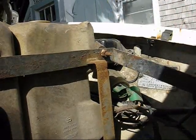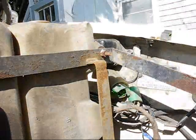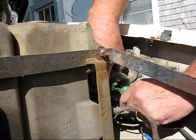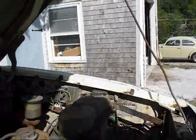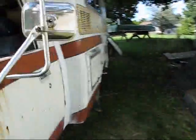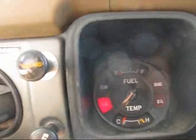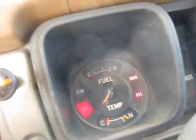I've got it disconnected now. Let me pull the wire off the battery. When it's connected and I connect the battery, you can hear it click. And also, when the battery is connected, my alternator light inside stays on. You can see it right there. It says 'charge'.